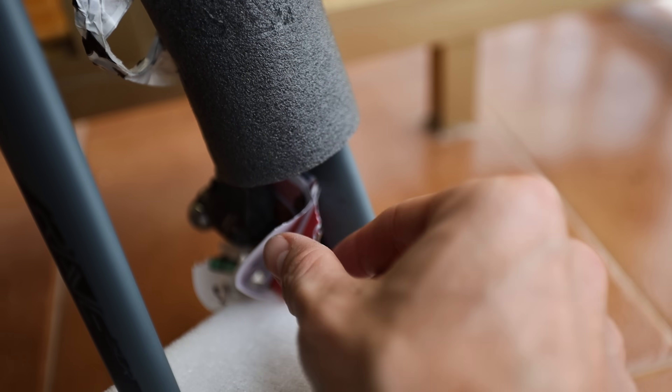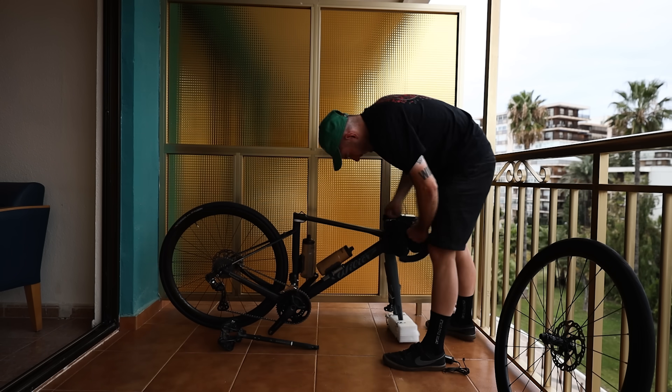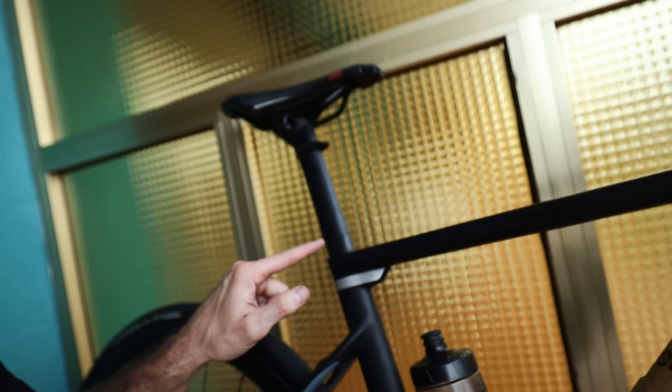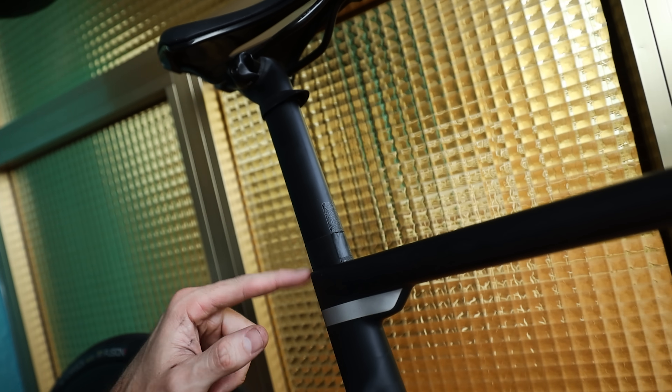Make sure the front wheel is taken out. If you're using disc brakes, make sure you put something in between the caliper, just in case your lever gets squeezed so the pads don't stick together — something as simple as a clean plastic card or a piece of paper works. I keep stuff I might need at the other end, like a Di2 charger, a set of allen keys, and my thru axles, all inside the pouches of my bike luggage, so it's ready to go as soon as I open the box. A small piece of electrical tape at the top of your seat post to mark how high you have it is a very handy thing to do.